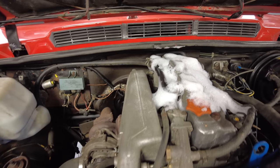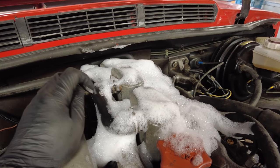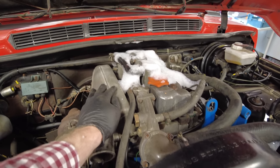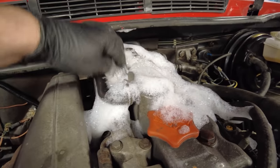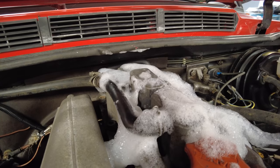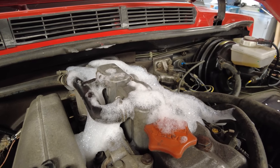Right, we're all soaped up. Start it up — yeah, it's definitely coming up from in between here. So we've got a head gasket gone if it's coming up from in between there. We're going to have to take the manifolds off to work out exactly which one it is. Lucky the head gasket hasn't gone completely — there's no oil in the water — but it's definitely leaking in here.